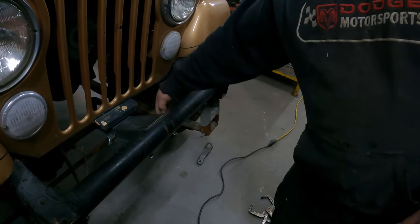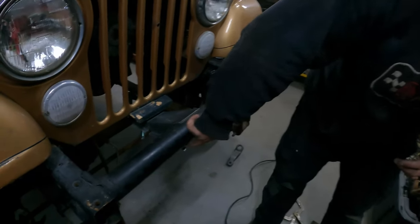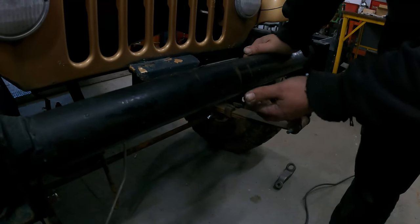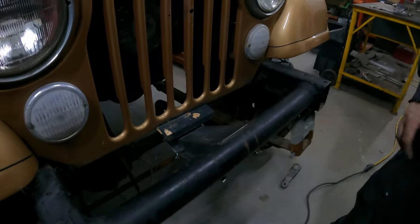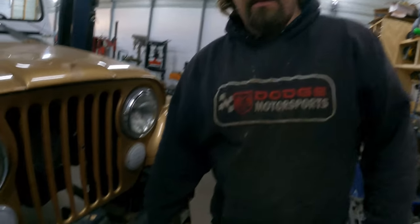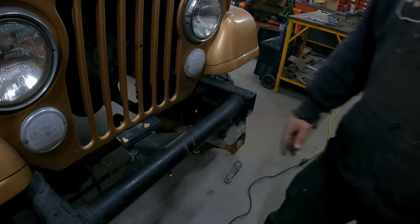I'm not gonna do that. I'm gonna weld it on the outside. And then I'll just bend these tabs around. I'll weld this end of these. Weld in here. I might just weld the ends, actually. I might weld the end here, the end there. Weld the inside here and across the top there. We'll see how I feel about welding once I start trying to TIG weld overhead on rusty metal.